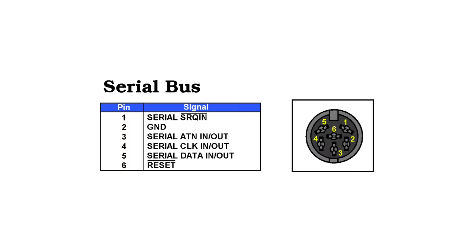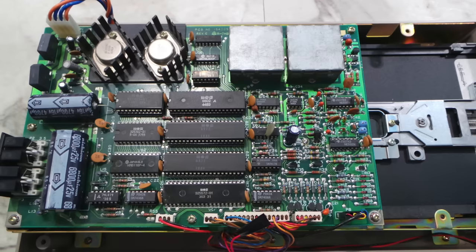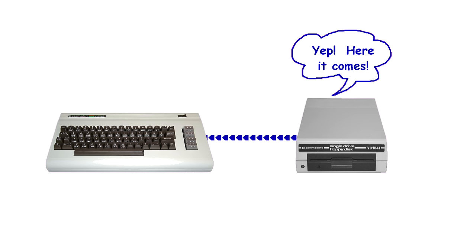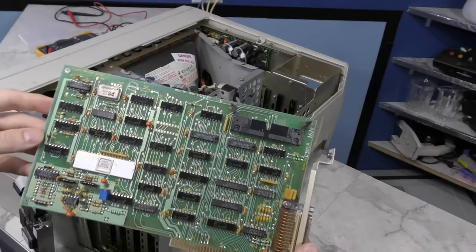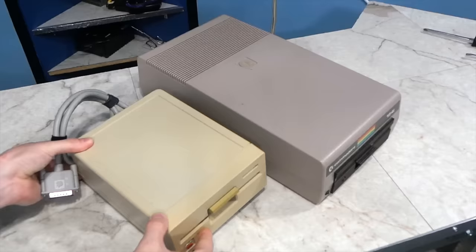The Commodore IEC interface is just a serial port, and while it's notorious for being slow, it did have some significant advantages over competitors of the era. The inside of the disk drive had its own 6502 CPU, RAM, ROM, and it contained its own DOS. Thus, the computer never needed to know anything about the physical media that was being used. All the computer did was request a file, and the drive would deliver that file. This meant that the computer didn't need to allocate any RAM area for any sort of DOS like an Apple II or an IBM PC would have needed to do. It also meant there was no need to disassemble the computer and install a disk controller card. And surprisingly, it also meant you could in theory use a variety of media types, including hard drives or different types of floppy disks without the computer really caring.